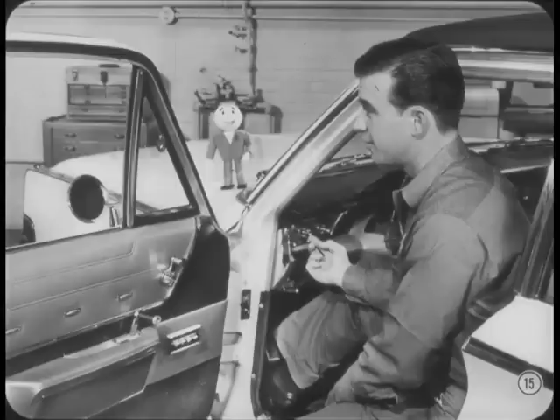I'll just turn on the parking lights, and if one of them doesn't light but it comes on dim when the turn signal is turned on for that side, then I'll know it's a bad ground. Nice going, Bob.